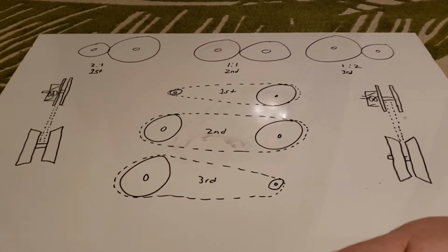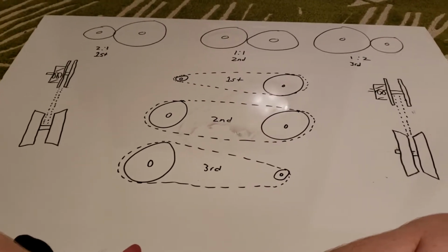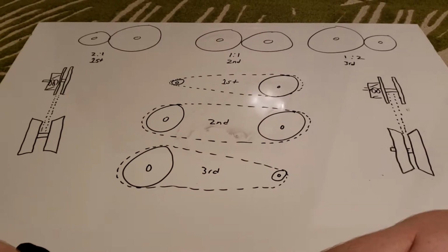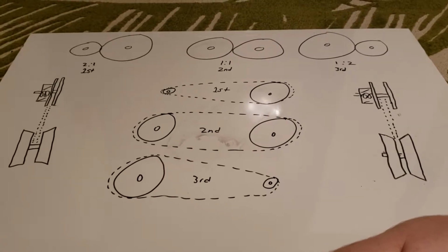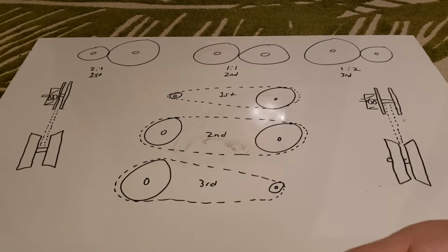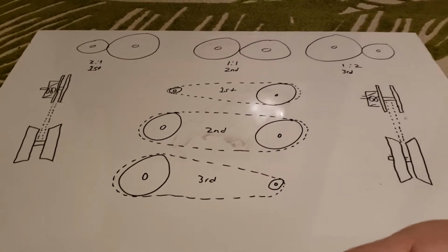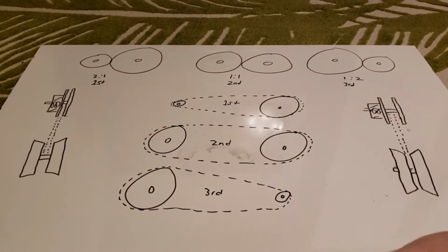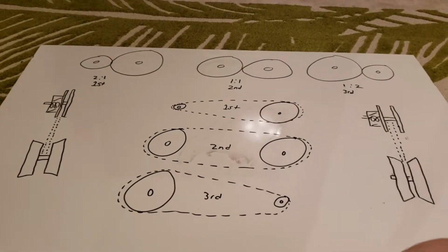Now, I know there's a different variety of torque springs out there now. When I bought mine, it was only the factory or an upgraded torque spring. Now you can get many different weights, so there's a tuning aspect to it. I'm not familiar with that. Most companies selling those are going to have it kind of broken down for you. So if you buy a tuning kit for your golf cart, they know which one to give you. Or if you just go on eBay and buy a torque spring, you can't go wrong. I have the yellow one. They seem to be color coded, but the one I use is yellow.